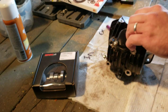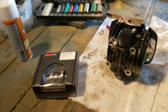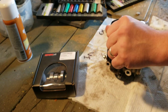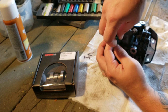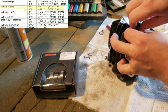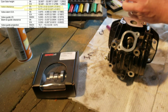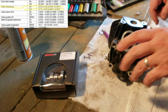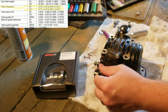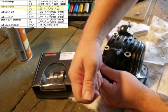We're going to take these little inspection covers off. Underneath here are your rocker arms. Set those aside and be very careful with these — don't break anything. Remember, inside where those shafts are there is a needle bearing, so you want to be extremely delicate when you take that out.